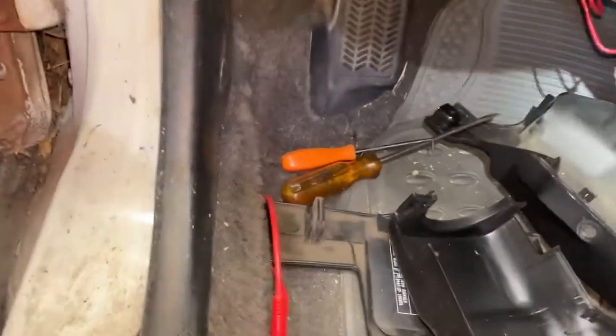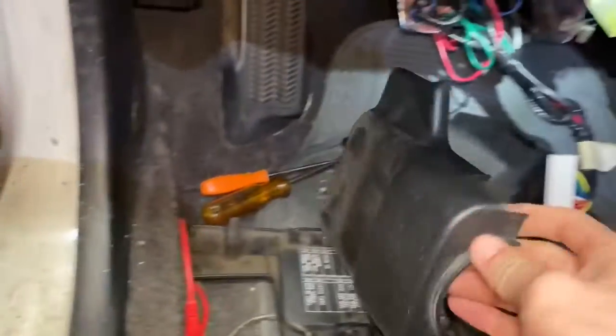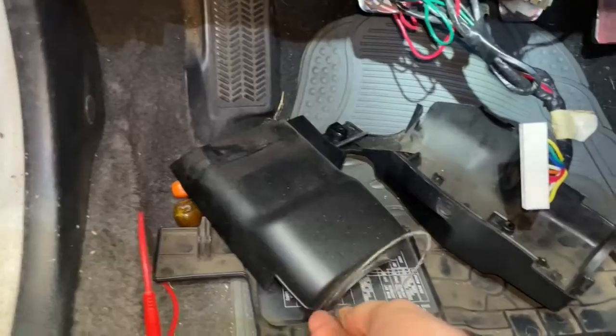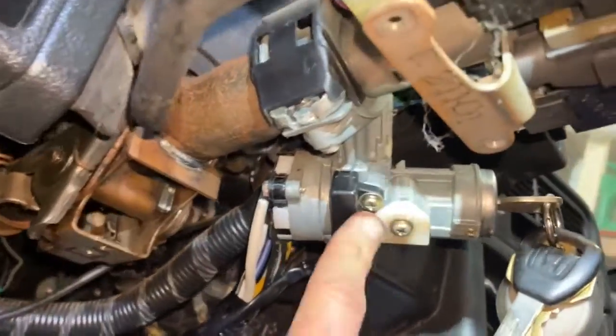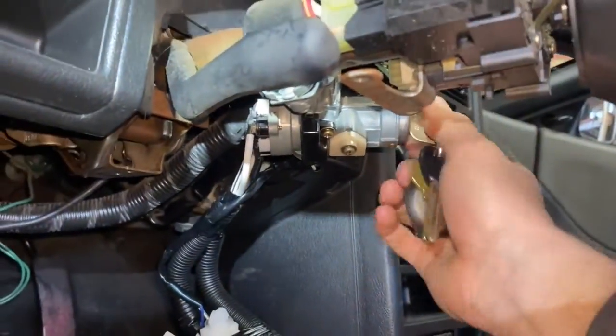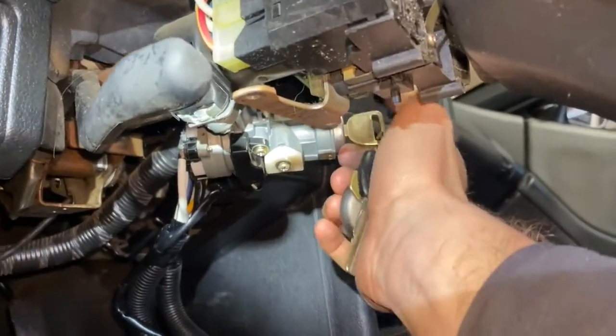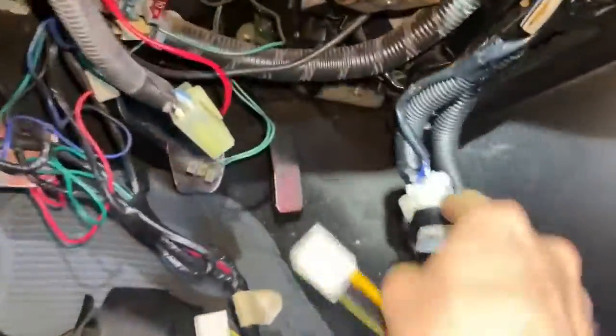This is the C-clip that held on the bottom piece, and this clip right here basically holds the center ring around them. When putting this all back together, make sure you reinstall this piece and that Phillips screw. There are also two other screws on either side of that. You can check installation by feeling the key — you should feel a little spring-back when you go to position three. If you do, you know you installed it right and it's sitting in there flush.